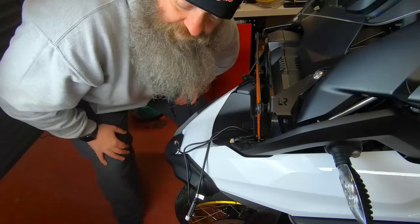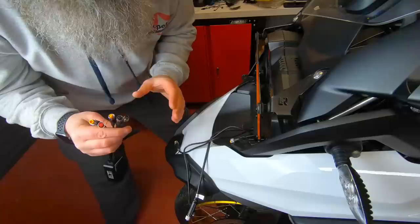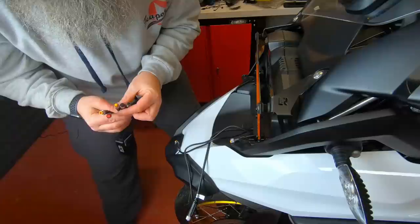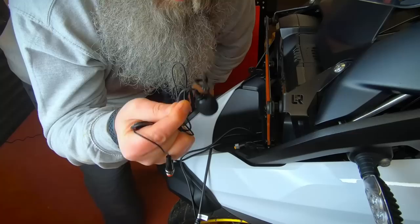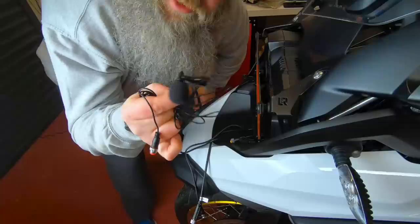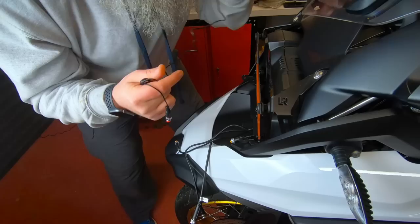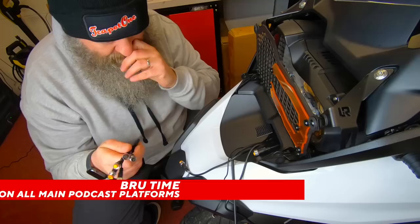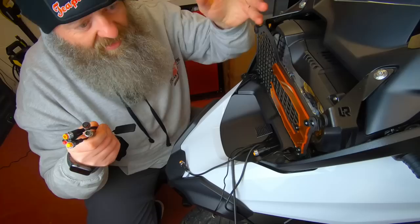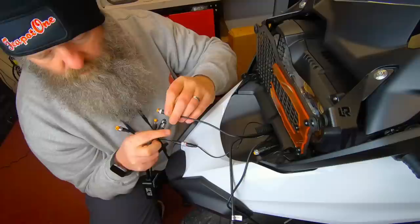I've pulled all the cables through from the front — there's just enough slack to connect everything up. Thankfully everything is color coded. The K5 also uses an external mic input direct to the DVR. You can either put that somewhere on the bike for engine noise or try passing the cable up into your lid for a bit of motor vlogging. I'm going to try both — for the time being I'll just have it dangling in the cockpit so I can wire it up into my helmet. All color coded and the connections are all waterproof — don't over-tighten them. It is a little bit fiddly, female to male, but all done.